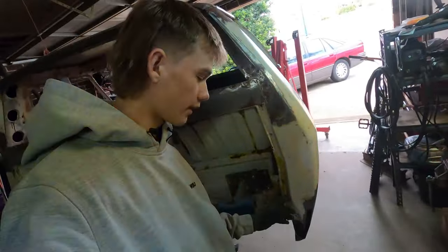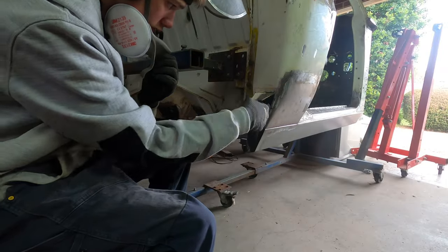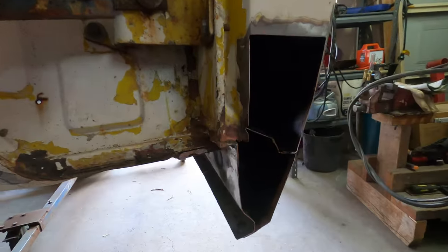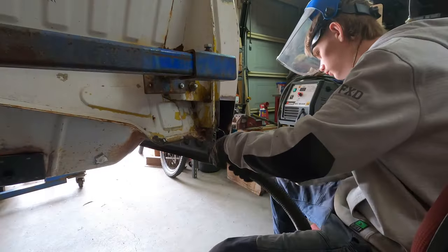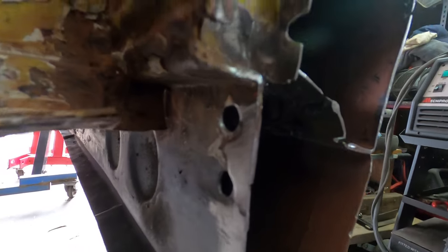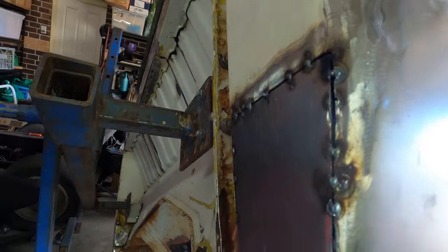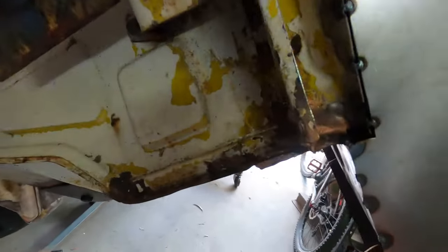Now I'm going to start working on the back of the driver side sill. Everything is prepped and in place. I had to weld up two little holes that were drilled out a while ago, and they are done. I've also painted inside there so everything will be protected. Got it all tacked in place — the gaps are a little bit thicker than I was wanting, but it's all lining up. We'll come back once it's all welded up and ground back, so let's cut to then.